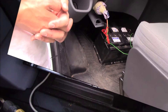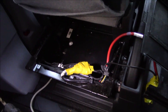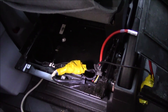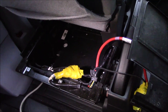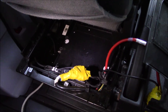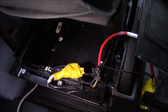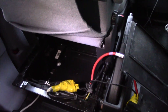I've now taken the main battery out of the car. Normally if you'd done this, the radio and all other subsystems would have lost their power, but since we've got the battery saver plugged in, I should be able to do whatever maintenance I need to do, plug the main battery back in, and the battery saver will have retained all the settings so we won't have lost any of them in the interim.